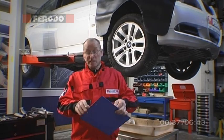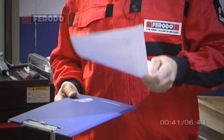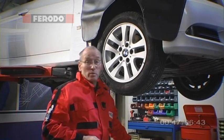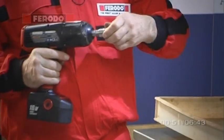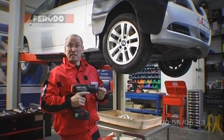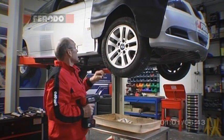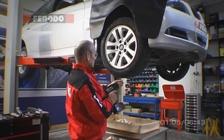What I'd like to do is, so that this schedule remains clean and intact but visible, I'm going to attach it to the vehicle with a magnet. And begin taking the wheel off — I'm going to use a power tool. I've no problem using a power tool for removal, and on the refitting of the wheel, we shall of course use a torque wrench. I've obtained the security socket, so we'll begin by taking that nut off first.